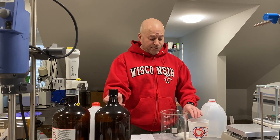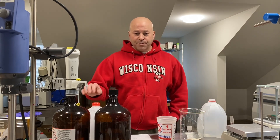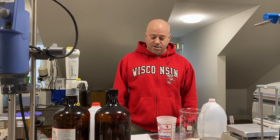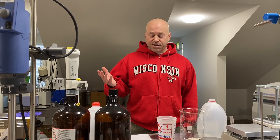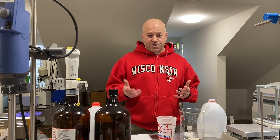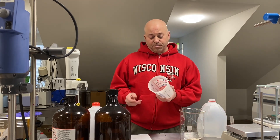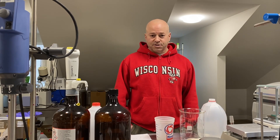The first thing I'm going to do is add the methanol. This recipe I'm using is going to have a freezing point of minus 40. It's January, so I figured what the heck, I might as well make a pretty good winter blend. The blend for winter is going to be 46% methanol and 54% water. I'm going to translate all that to ounces, so if anybody wants to make this using volume and you don't have digital scales, if you're using a paint stirring can like I got from Lowe's, you're going to need to measure out 59 ounces of methanol.